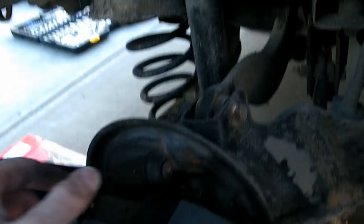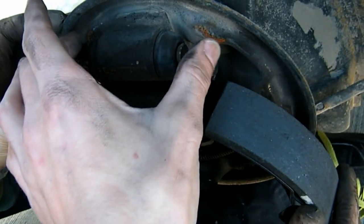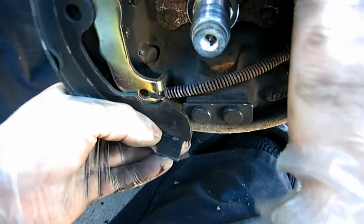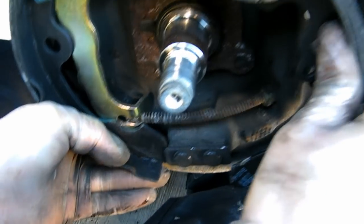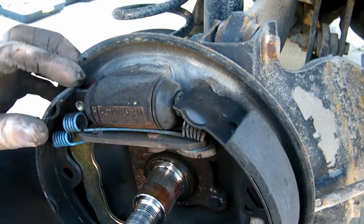You've got to make sure that the top of these pads right here are over top of the cylinder. And you want to make sure these parts go underneath the lip here. If you look closely, this part is in front — you want this in back. There we go. Beautiful.